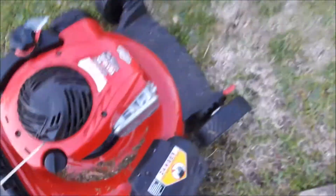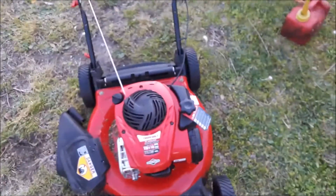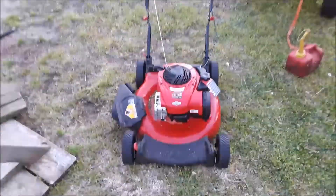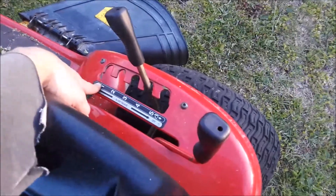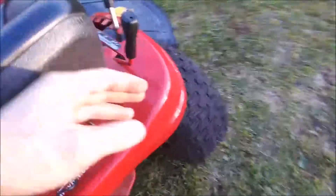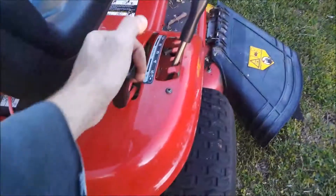Anyway, she's a good one — plastic, but good. Keep oil in it. It's a four-stroke so it should be fine with oil burn. She's a good one. Now I want to talk about the riding mower belt issue — I can mow on speed four and five, but as soon as I hit three, two, or one it's like the belt just doesn't engage. I got a 42-inch belt, I replaced it, everything's hooked up right, even the engagement cable going down here — I replaced the whole cable thinking that was the problem.